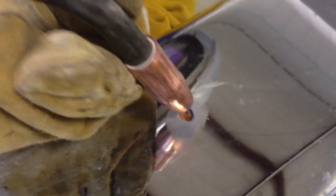You can see that I put it back behind the hole there. Now I can weld straight on top of that. I'm gonna use a plug weld — that's basically where you just weld around the outside edge of the hole and then spiral inward. That makes a real nice, clean weld, and it's not gonna create a bunch of grinding or clean up time.